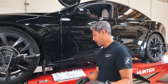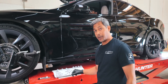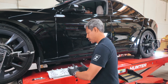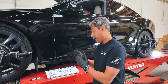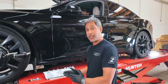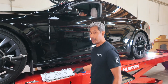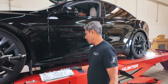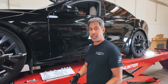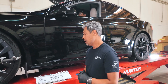What does happen is that you go from minus 1.8 degrees of camber to minus 2 degrees of camber, which leads us to believe — and the facts show, the data shows — that it's the camber that must be the culprit for this inside tire wear. So what we're going to do is install these camber shims. This is your more affordable option to correct for camber. The toe is adjustable — plenty adjustable from the factory on these P2s — so we don't need to get any toe arms.